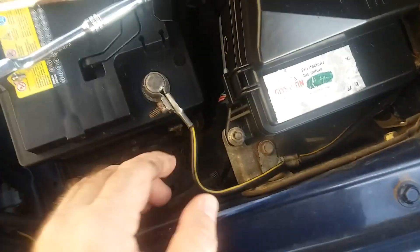I think it's still going to be hard to start because all the power of this car is going through that severely corroded copper. You might say those strands are pretty thick and there's miles of copper. While that's true, electricity wants to travel on the outside of the copper — it doesn't go through the center, it skims across the surface. With the surface corroded, even if the wire isn't corroded all the way through, it's going to hamper its effectiveness.